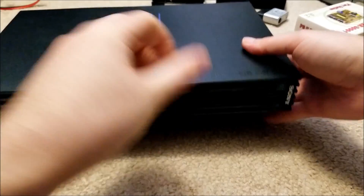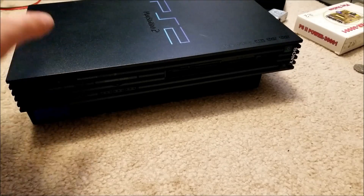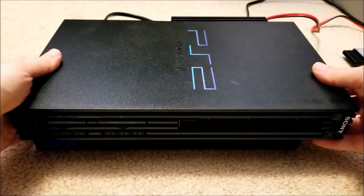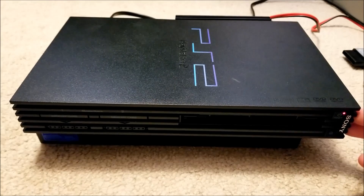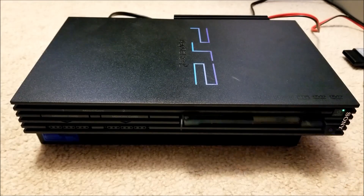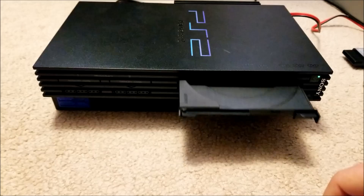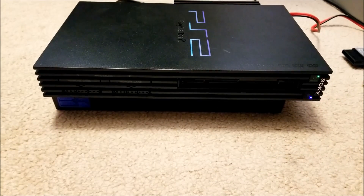Let's grab a power cord and see if this turns on. I've already confirmed that video works and everything and I didn't mess with anything else. Might as well plug in the hard drive too. So we're all back together — power on the back on, red light comes on, good. Turn this on, hear the drive go off, hear the hard drive spin up. And let's eject. This belt I think is maybe getting a bit stretched out, so I might have to replace that because it's a bit slower than I'd expect, but it's okay for now.